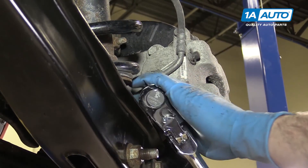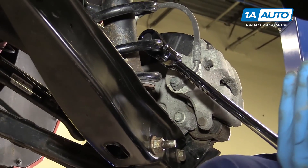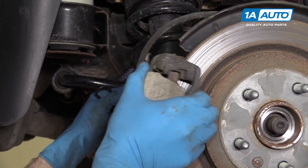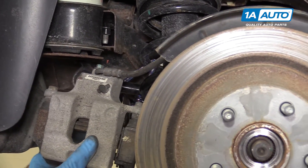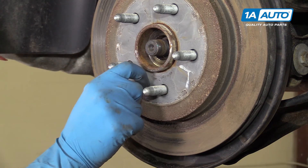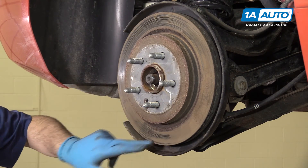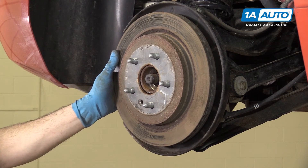We're not going to remove the caliper for this. We're going to move the bracket and caliper as a whole. So we're going to use our 16-millimeter socket and ratchet to loosen and remove the bolts. Make sure you have a bungee cord or some mechanics wire or a zip tie handy, so you can secure your brake caliper out of the way without putting the strain on the rubber hose. Using a T30 Torx bit and ratchet, remove your rotor screw. Release your e-brake. You may need to use a hammer to release your rotor. If you're going to be reusing it, you're going to want to hit the face and not the edges. This will free it up without damaging the contact surface of the rotor.